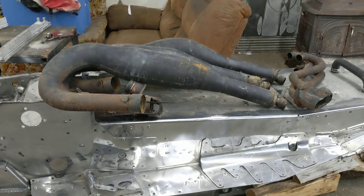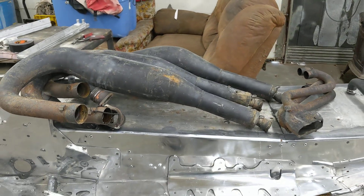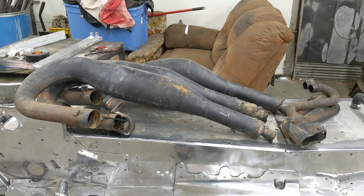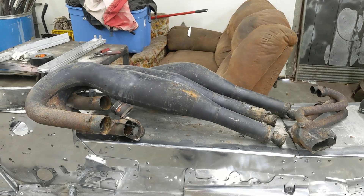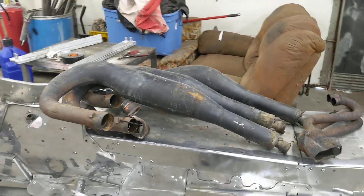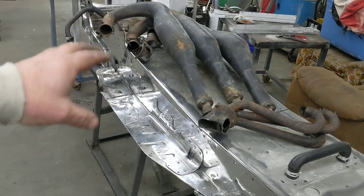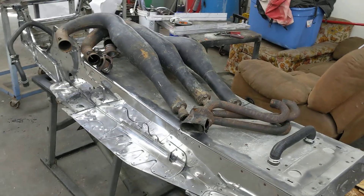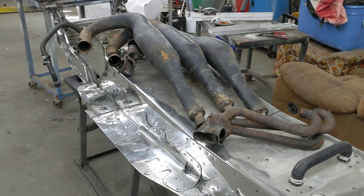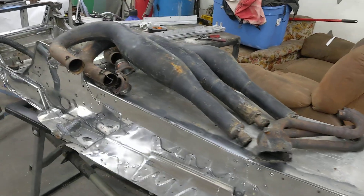I have pipes. I even said it in one of my first videos when I started building Redemption — I was gonna put it together as stock, run it for a while, make it prove itself, and then pipe it. You put a set of pipes on something, it's not always just bolt pipes on and go ride the next day. A lot more comes along with it. Ultras happen to be one of them sleds that are a little bit pipe picky. The right kind of pipe is a big one. Then you got to change your CDI box, you got to clutch it, you got to jet it. The list is five pages long in an owner's manual of how to pipe one of these.